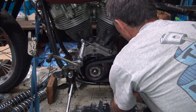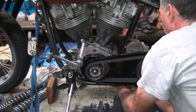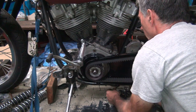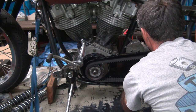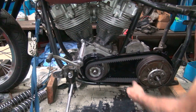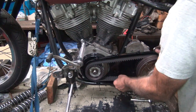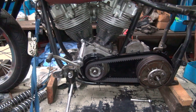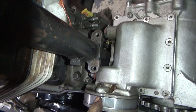I'm going to tighten up the plate underneath — transmission to the plate now. It's five bolts, four studs, and one bolt to tighten up. And we put the bolt over here — there it is. Tight. Built to actually loosen up slightly. I think the clutch up is a little loose too. Yeah, this nut's not tight — tighten it up. That's about right now. When I put that together for real it'll be good. So there's where the transmission is going to set — right there. We have a little bit, about a quarter inch clearance, the back of the frame there, which is good.